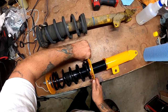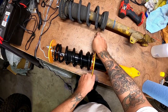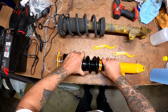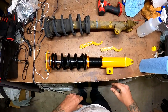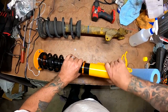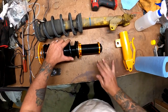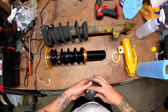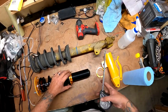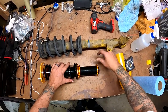After we have it locked up, the spring should be somewhat tight in there. Now I'm going to take this one loose and spin it completely off. I'll make a measurement from here to the very end — which looks to be about five and a half inches. I'll make a note of that, and on my next one I'm going to make it five and a half inches from here to here so I have them both set up exactly the same.